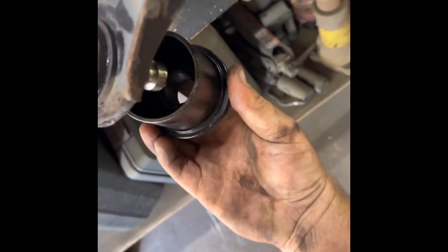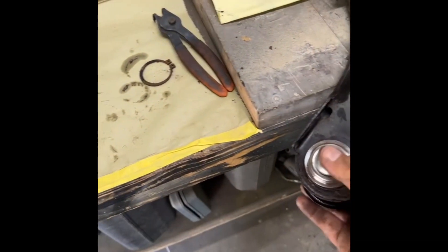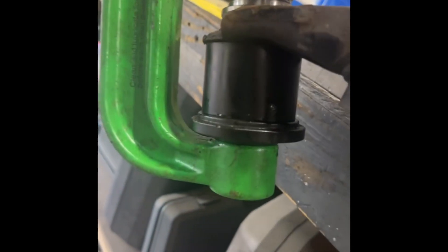Put the impact on there and press it down. Now to go back in, I turn this around upside down, put the ball joint in — this is going to go on the bottom side. See, there's a hole so the ball joint can get in it. Put that tool right there on the top and just run it down. I flip this over, got the spacer where this has a hole in it so the ball joint can come down, and just run it in.